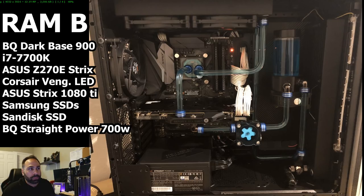This rear fan should be an exhaust fan. Most people use it as exhaust because you want to be exhausting hot air out of the back and top of the case. So these top fans should be exhaust — one and two exhaust — and then these front fans are intake: one, two, three intake fans. If you have one and two exhaust at the top, this rear one should also be exhaust so you have a nice neutral air pressure inside the case. Just flip this around so it points in the other direction and blows air out of the case instead of into it.